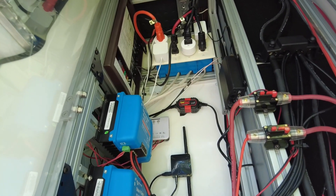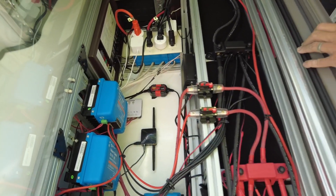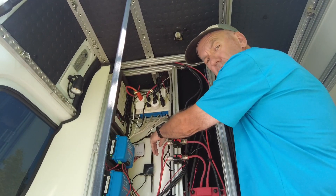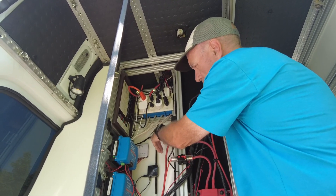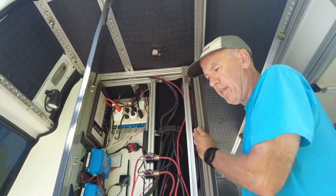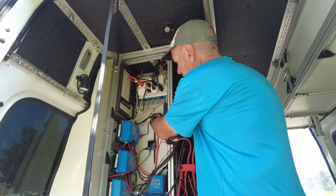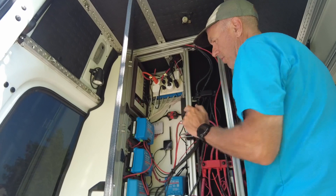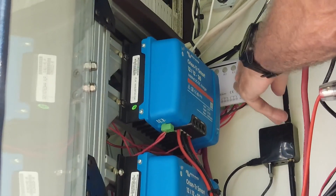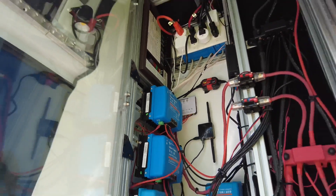I added a trickle charger because the chassis battery has phantom power sources coming off it. We left it for two to three weeks and when we came back the battery was dead. So I added this Walmart trickle charger for the starting battery. It runs off 120 volts, so the inverter needs to be on, but this keeps our starting battery charged at all times — like having a battery tender on your boat during winter. Everything is also hooked through Alexa. These power our outside lights — we have a light on each side of the van. There are switches to turn them on manually, but we can just tell Alexa to turn on the outside lights and she does it.